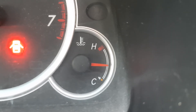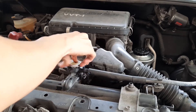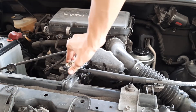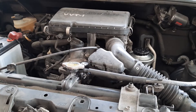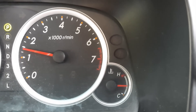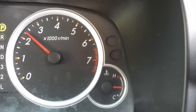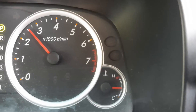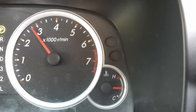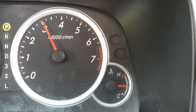Let the temperature and the coolant level stabilize after the engine has reached operating temperature, then you can cap off the radiator and we are almost done. Just get the car off the jacks so the car is leveled again. Double check the coolant level after that and then do some tests — rev up the engine and make sure the temperature is completely stable.